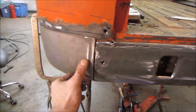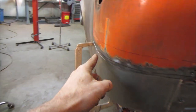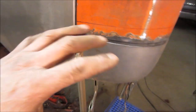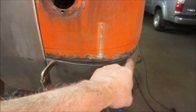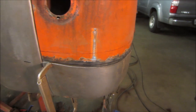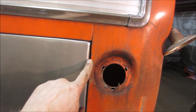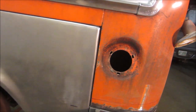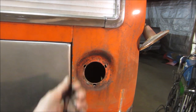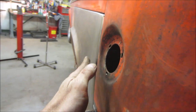So this will butt right up to it. It will kick over just a little bit, but there's a clamp between these two. So if I release that, get a couple of tacks on that first, then come back and clamp this again, it'll even get tighter on this lip. Again, this could have been a sharper bend. That's all right. There's no clamps up here yet, neither. When I clamp, that gap will close up a little. The curve looks good that way.